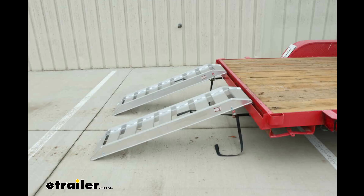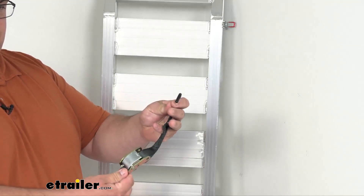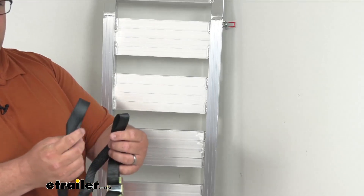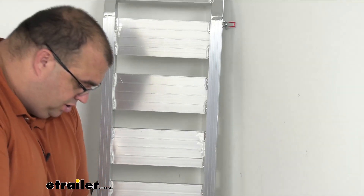If you notice in that image, you've got a strap coming off of that third rung down on the ramps, and it goes through an eyelet, comes back through itself, and there's an S-hook that goes under the trailer frame — that helps hold them in place securely while you're loading and unloading the trailer. I do have that strap here to show you. Got an S-hook on one end, a nice cam buckle here you can tighten or loosen. Then you've got two loops, one on each end, and that'll just loop through itself around that third rung from the top.